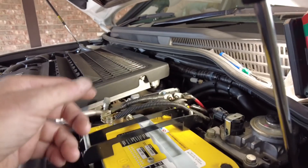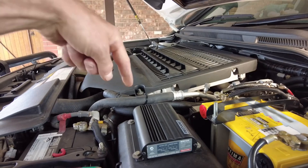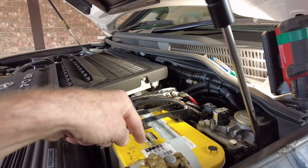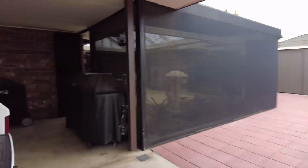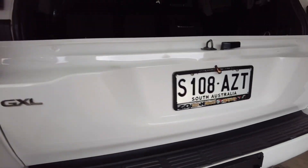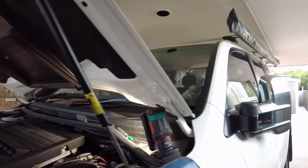I'll quickly explain it as simply as I can. The DC charger is the link between these two batteries. The starter battery feeds the DC charger, which charges this auxiliary battery at a rate of up to 40 amps until it's full and backs off. This then runs to the Anderson plug at the rear of the car. The other end of that Anderson plug is the drawbar of the caravan, and from there an Anderson connection goes to another DC charger, which runs to the lithium batteries.